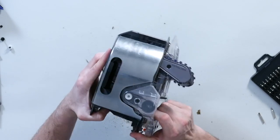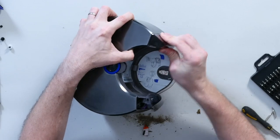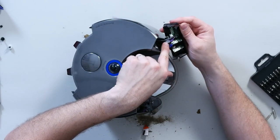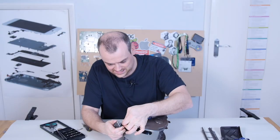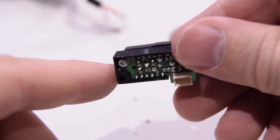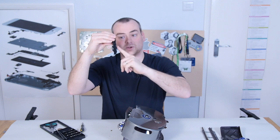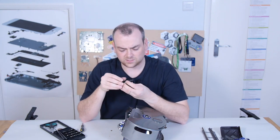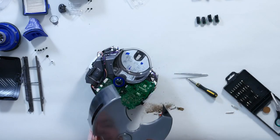Looks like that has released the base. That screw on the bottom looks like it's actually released these sensor modules. Just like we saw with the Sanyo projector, all the connectors are nicely numbered, so it's hard to get it wrong. For each module there's an infrared LED and a receiver, and these two point down. They'll have varying ranges — one will be for very close range and the other slightly longer, about an inch versus half an inch. They are standard modules, all numbered, and they look like they clip in place.